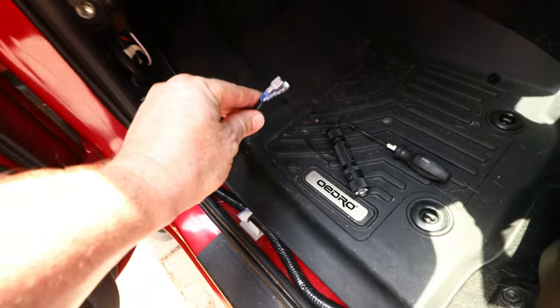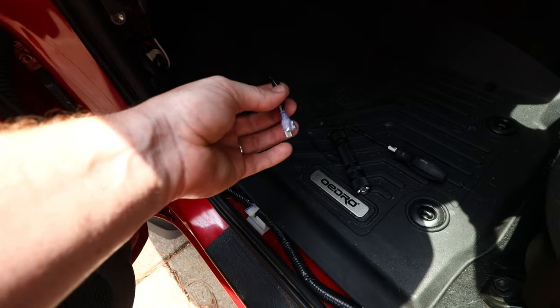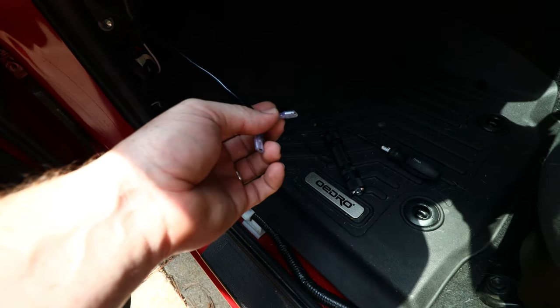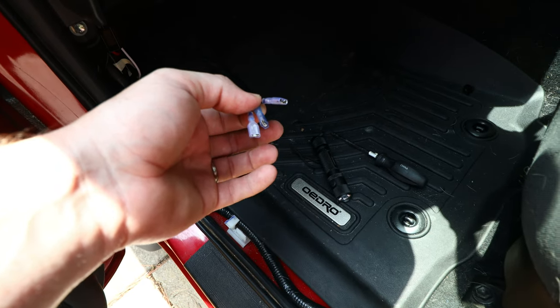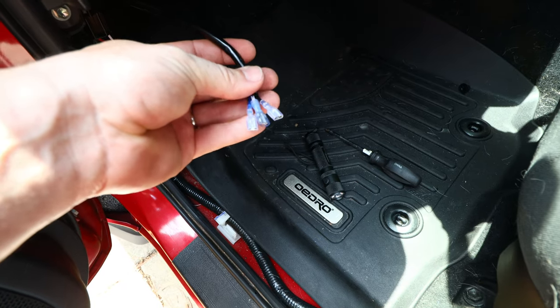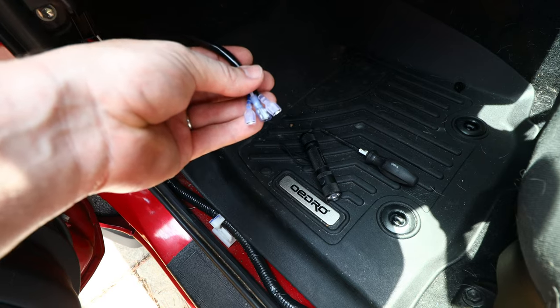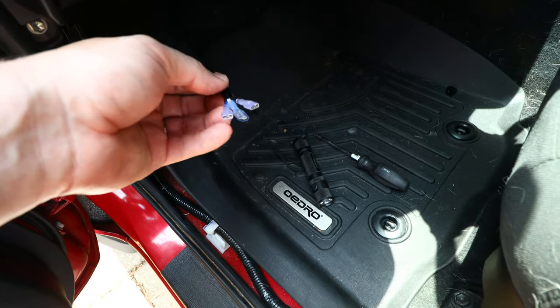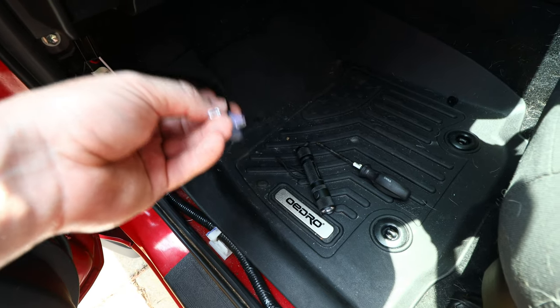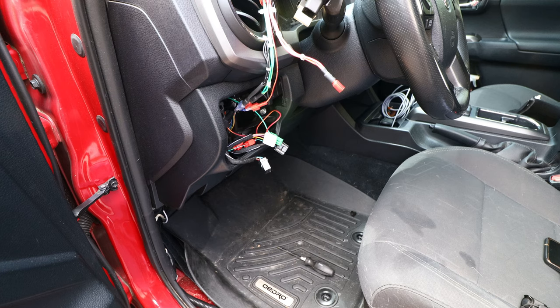This is the wire harness that comes with the hidden light bar I'll be showing in the next video. The black wire is my ground wire so that will connect to all the black wires on the switches. My white wire is the power wire going from the battery through a fuse and sends power to my switch. And then the blue wire is the wire that will send a 12 volt signal from the switch to the relay that powers my accessory. So I'm only having to use three wires, and then the blue wire will connect to the individual red one wiring for the LED light bar switch. Now that the three main harnesses are connected, the last thing I need to do is tap into the illumination circuit so the aftermarket buttons will illuminate anytime I turn on my headlights or anytime the dash lights are on.